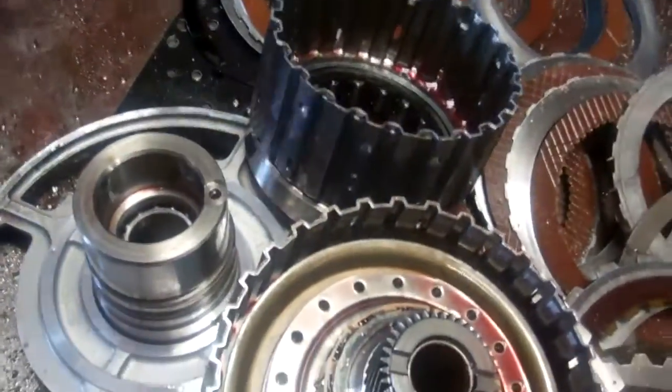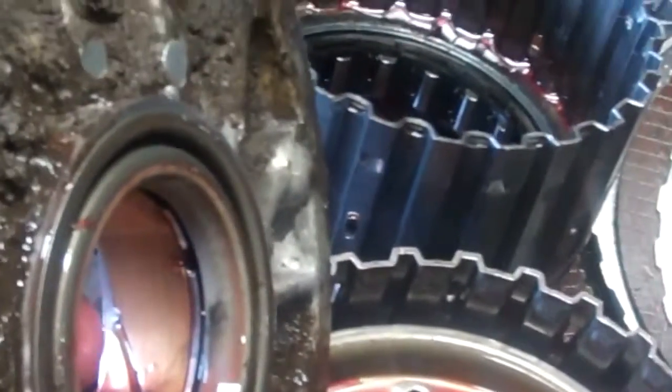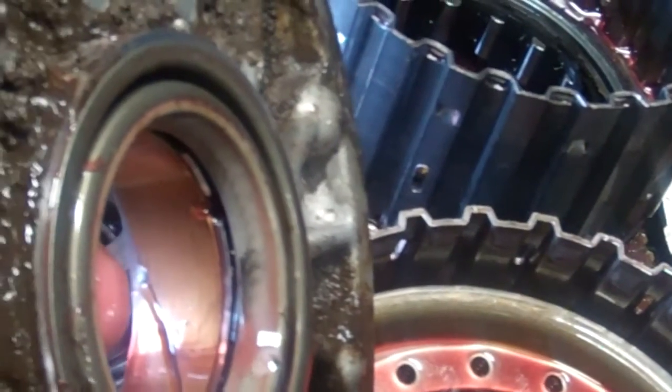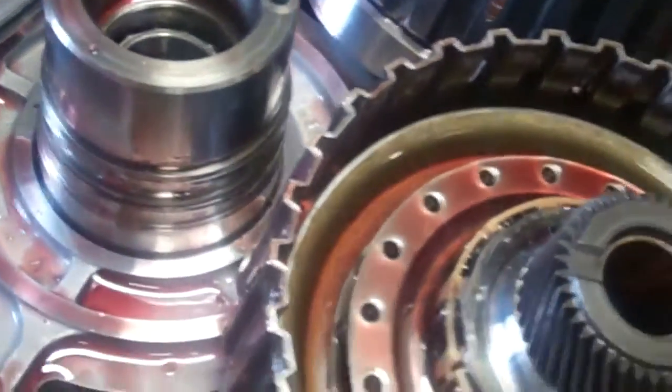Our pump, the real reason for the problem is the front seal. If we look at the gray material of the seal, you can see these lines on here. The lines really should go all the way to the end. So this seal, the rubber is worn away in the seal. So the seal is going to be the reason for the leak. And as I said before, all the aftermarket seals are far better than this seal that's inside there. So, realistically, changing the seal in this case, it probably would have worked okay. It wouldn't have helped the wear we're seeing here, the wear on these bushings, and the wear here.